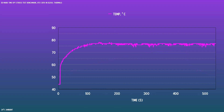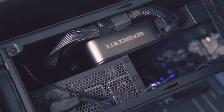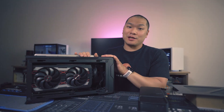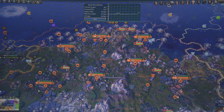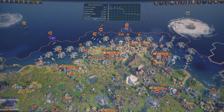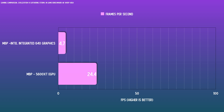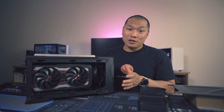One of the initial questions I had was what happens when you've got this partial obstruction of the flow-through cooler, because exhaust comes through here, but there is also ventilation from the power supply fan too, so it's okay. Gaming in macOS is a bit iffy in addition to the titles that are even available to run. With Metal API, the 5600 XT was able to significantly boost the playability of Civilization 6 at 1440p on high settings — though for Civ 6, 24 FPS is at the cusp of what I can personally tolerate. These are still very poor results; the 5600 XT is more than capable of 80+ FPS on a Windows desktop. So don't do any serious gaming on a Mac unless you're willing to put up with a processor and memory limiting your eGPU, which gets us to the conundrum that is the eGPU.